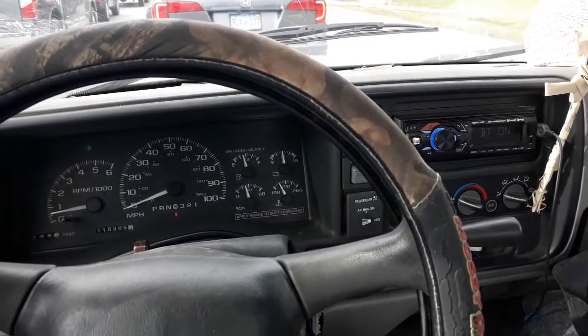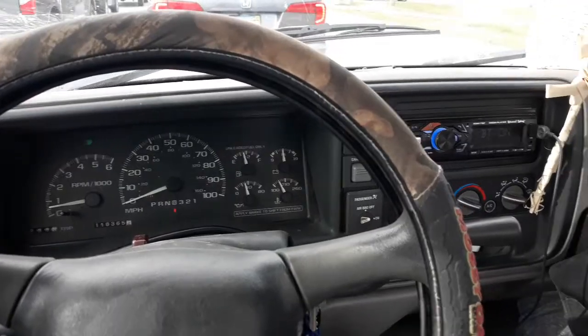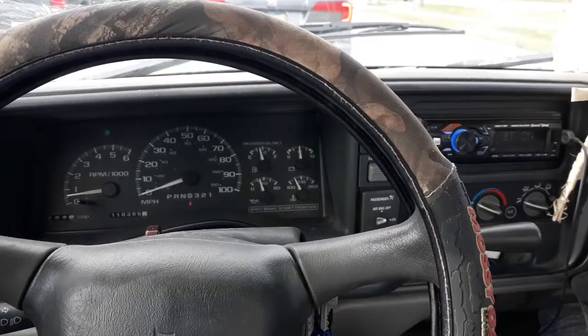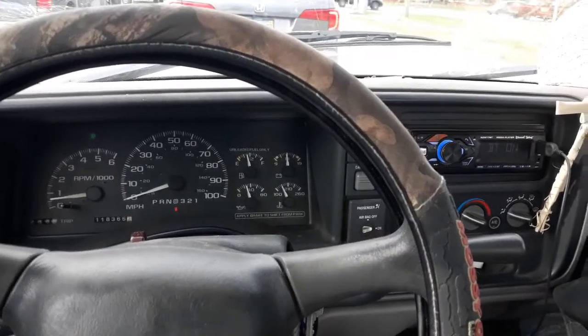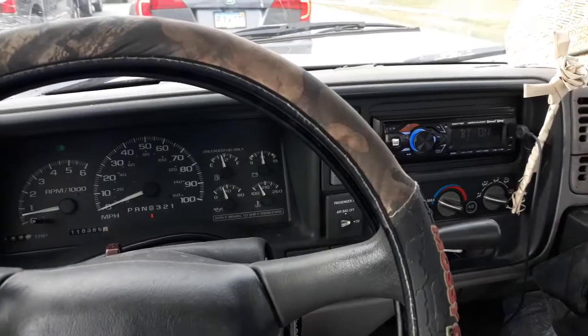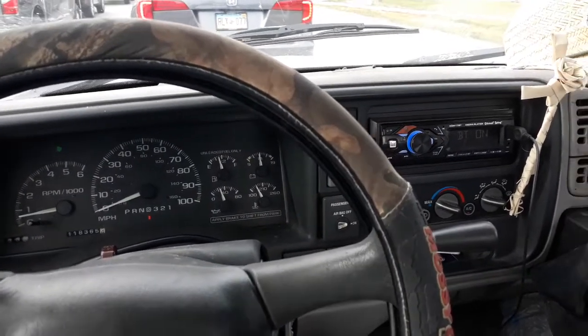And that is the reason why they put these switches on the accumulator, so whenever you have it on low, it will cycle the compressor. I just wanted to bring that up. In the next part of this video, I've got a replacement switch on the way, and we'll show you on the scan tool how it starts cycling like it's supposed to.